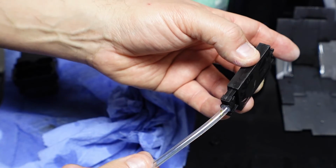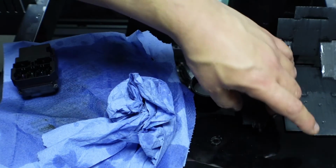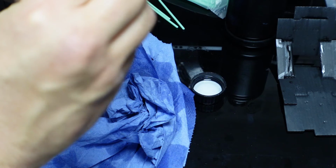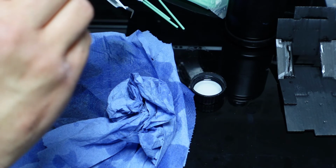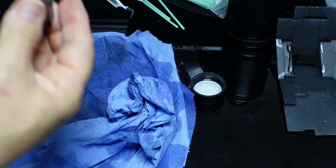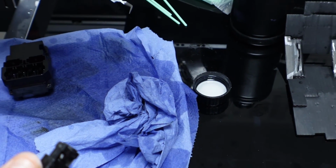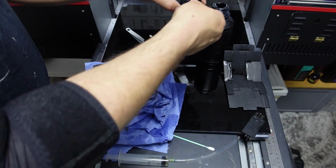while you're there is to suck some of this, so this would be connected to your machine, and you go into the bottom end and suck some of the ink through. You can do that. You will want to have made sure you've done a little bit of a clean at the back. So if you're doing this to the white, I suggest in well print, run a couple of strong cleans first so that at least it's had a chance to try to come through, and make sure it's been on for a little while so that it's stirred it. I'd also go to the back of the machine and try to shake the ink pots a little bit. Shake them up a bit so that you're not just pulling through dud old ink.